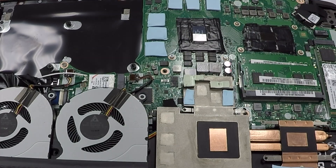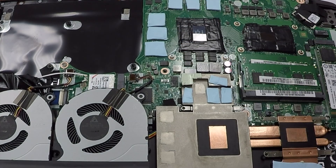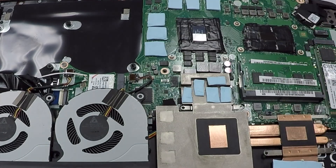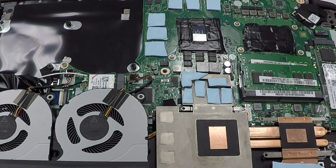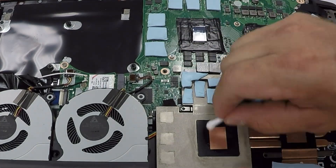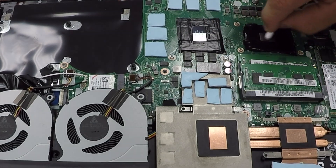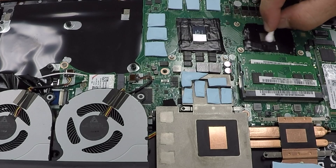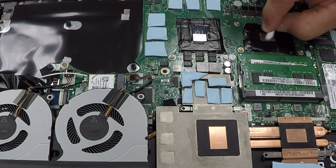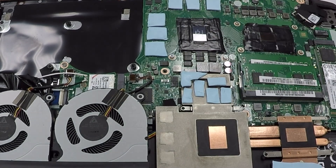The heat sink doesn't put a lot of pressure on the GPU since there are only three screws, so making sure the height of the thermal pad is really critical. You don't want too thick a thermal pad because then you won't be able to squeeze down and make sure the liquid metal is making good contact with the copper heat sink. Before you put on the liquid metal, ensure your GPU and CPU dies are really clean — take your 99% isopropyl alcohol and scrub them clean. Do the same thing to the copper heat sink plates so everything is good to go.